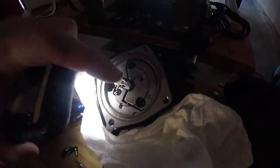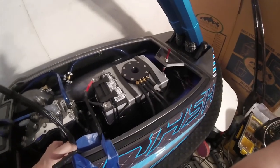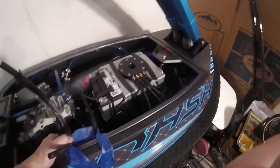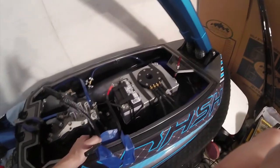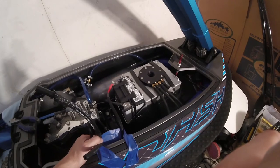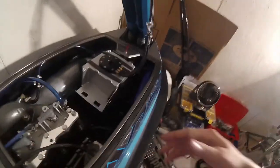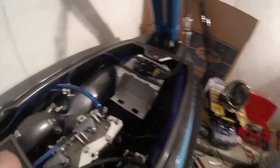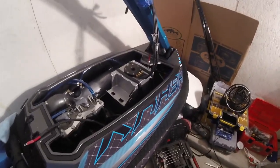Just full of crap. Time to remove the tank — I think that's what's causing my problem. Somebody suggested sandblasting the metal tank for welding, so I cleaned it out. I thought I'd cleaned it well, but apparently not. There are tiny little bits of sand in the carbs that's causing it to hang. I just hope I haven't damaged my motor. Really, really upset right now. Tank's almost out, battery's out — just going to take the tank out, clean it, put new filters in, and try again.